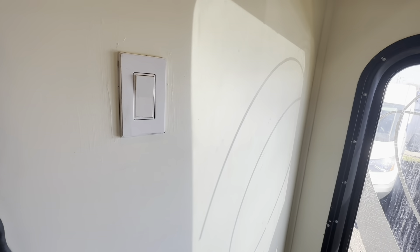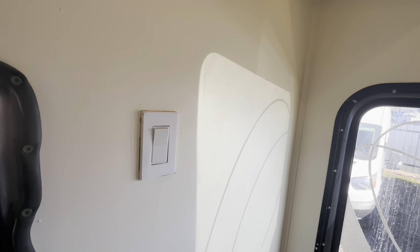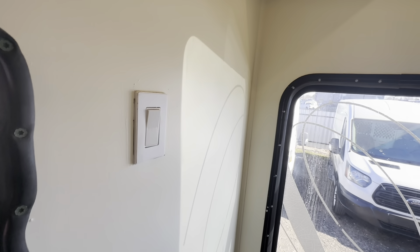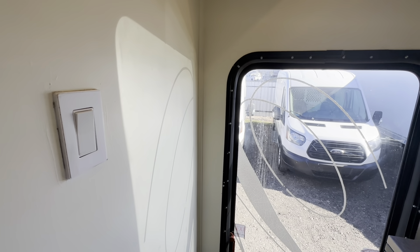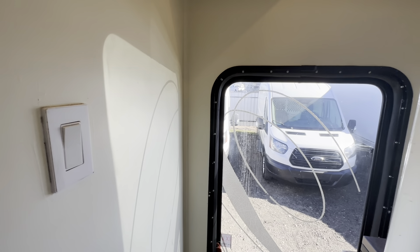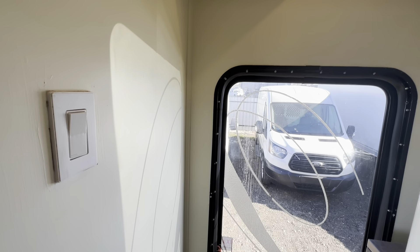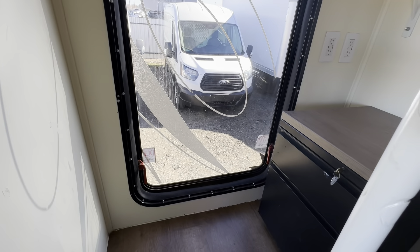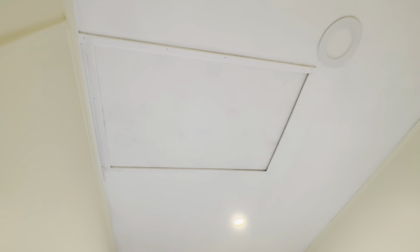The third light is connected to an external outlet on the outside of the truck, just below the corner of the window. If you take an extension cord and plug it into a regular outlet wherever your truck is parked, that'll give you electricity for the entire sleeper — TV, microwave, everything — without having to have your truck running all night. Combined with the engine block heater and external hookup, you should be able to keep your engine warm through winter while also giving yourself electricity overnight.